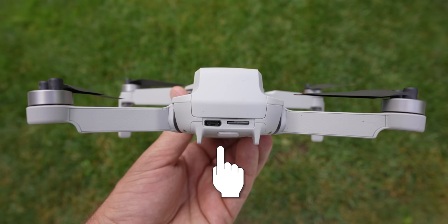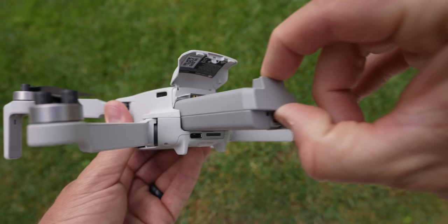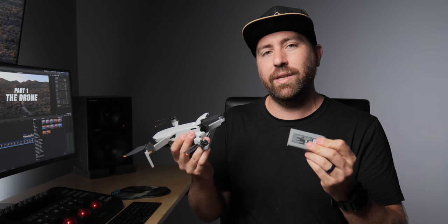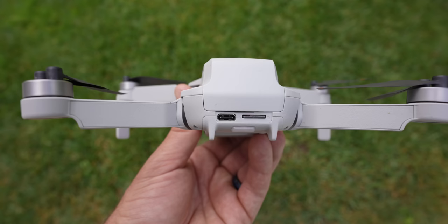There's also a button with a light used to re-link the drone if the controller loses connection, and the backlight changes colors to indicate drone status. To take out the battery, squeeze the little tab, press up, and pull straight out. It comes out much easier than the original Mavic Mini. Plug it back in, close and lock the battery door — you'll hear a click — and the drone is ready to fly.